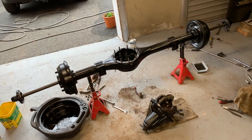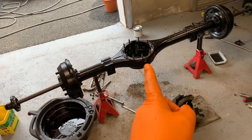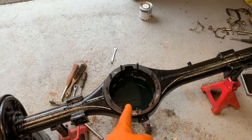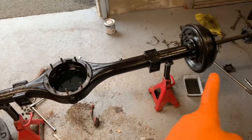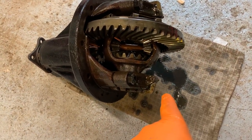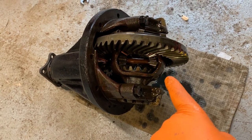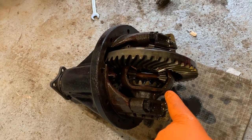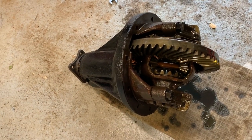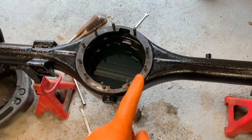It looks like there's been an explosion within the axle, but the half shafts came out quite easily without too much of a struggle. The diff, being heavy and needing to be lifted vertically to clear all the studs at the same time, was a bit of a challenge — but I won. The oil is nice and clean. Looking down into the axle, this is confirmed as an earlier type differential — it has a split pin in the little holder rather than a roll pin, and it's also wired through the top of the nuts. The little teeth don't seem to have too much wear and there's not a huge amount of play.